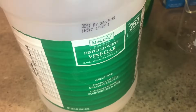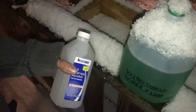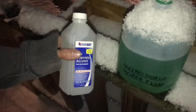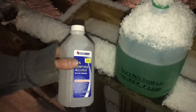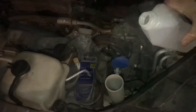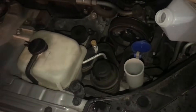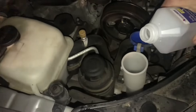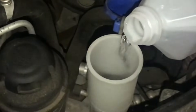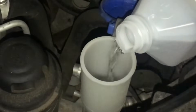Vinegar does act like antifreeze. Some people use rubbing alcohol instead — it's a little more expensive and it doesn't have that vinegary smell when you spray it on your windshield, but that vinegar does a really nice job of cleaning. If you do a freeze test and it's not strong enough, you can always add in some rubbing alcohol. And if I find a southern car where the system's frozen, the first thing I do is put in some rubbing alcohol, put it in the garage, and hope that things didn't freeze and break.